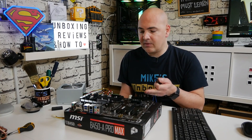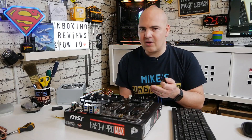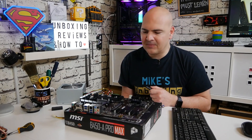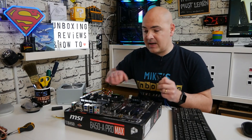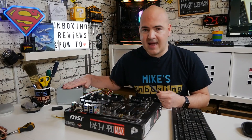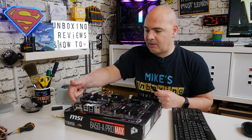You can try it with components on there — we have had people with success doing that — but I don't want to show you that and then have it not work. So this is the tried and tested method. You're going to need a bare board, a USB stick, and also an ATX power supply with a four or eight pin power connector for the supplementary connection.